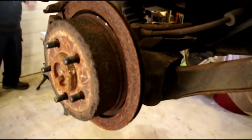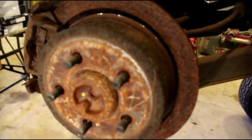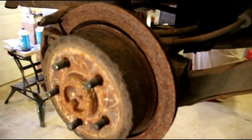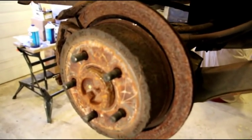Yeah, it all comes out. The truth comes out when the vehicle gets on the lift and the wheels come off. So we're going to tear this up and see how ugly it is. Hopefully the sliders will be okay for us, but new calipers, hoses, rotors, pads, everything. So we'll come back and revisit in just a minute.